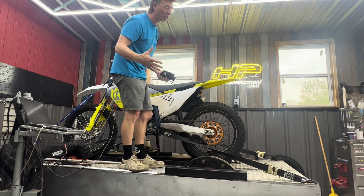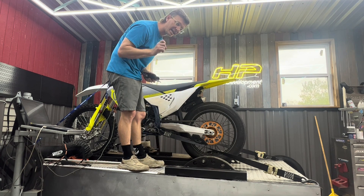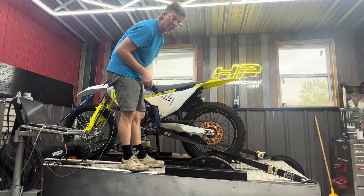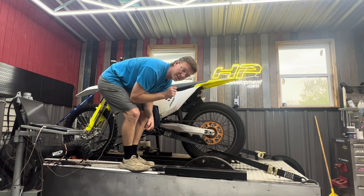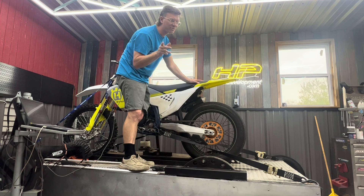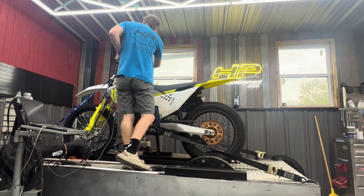Do I have to do anything else? Well, if we set your bike up right and you haven't screwed your bike up by totally ruining your TPS settings, it should fire right up. Luckily, we have a zero TPS procedure that if it is way off you can do that, but that's for another video. Let's see if she runs.